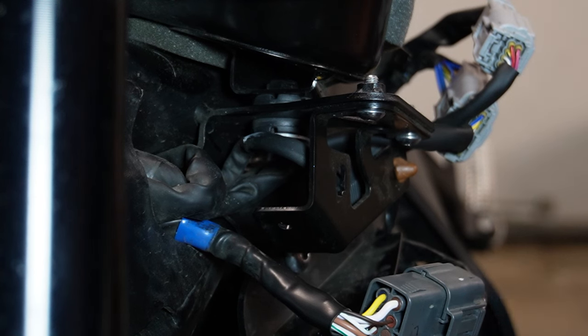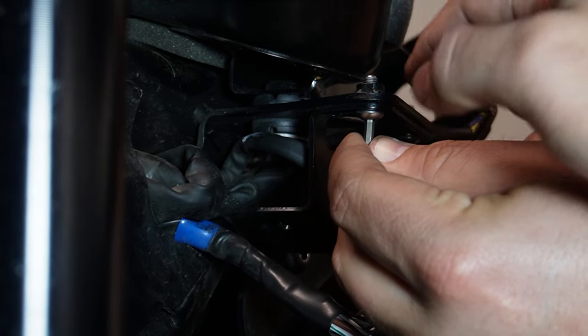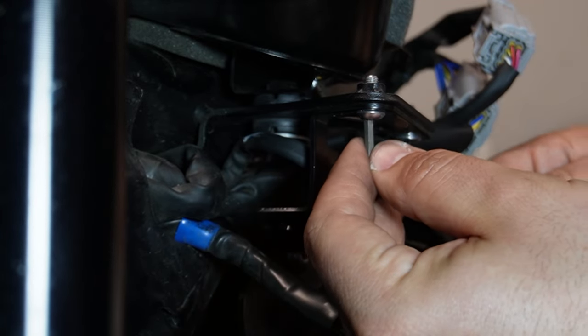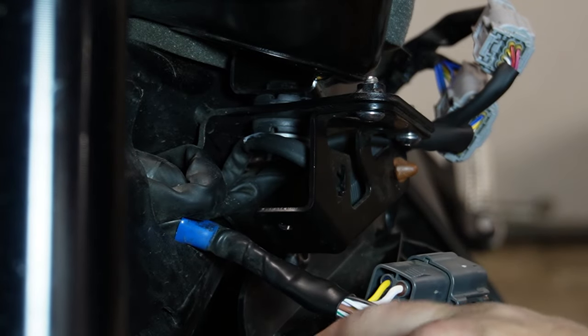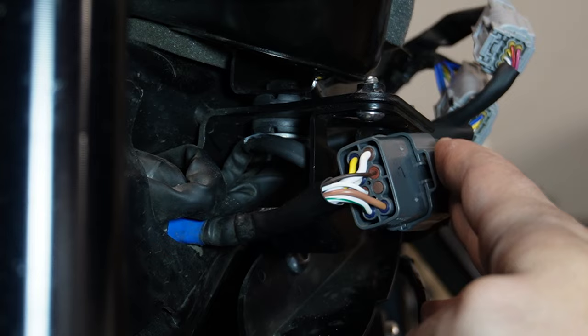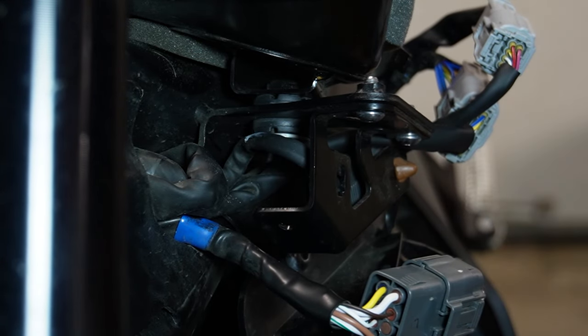Okay. So to get the left side of the gas tank installed, we're actually going to be removing this underplate right here so we can get the bolt in straight. And also we disconnected this little fuse box that's right here, and this wiring harness, which just clips in right here. But we're going to be taking off this little quick bottom bracket, and it's a 3mm Allen.